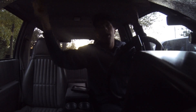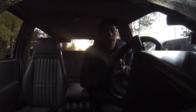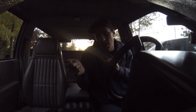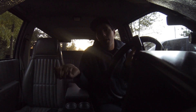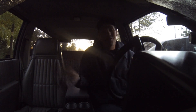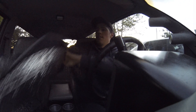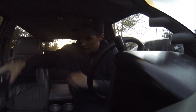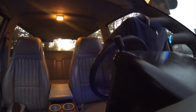I was able to bleed the brakes on the driver side. Number one, I'm starting to run out of daylight so it's getting harder to work out here, and this isn't urgent. Number two, the front caliper on the passenger side — the bleeder screw doesn't want to come out. It's pretty stuck; I'm probably going to have to put vise grips on it. I have brand new calipers, rotors, and wheel bearings in the house, so not a huge loss. But I'd like to see if bleeding the brakes on top of the truck will have removed most of the air.